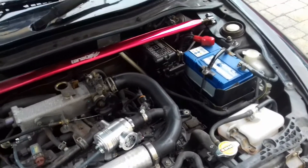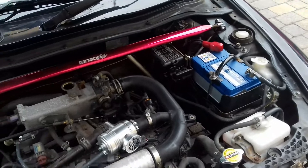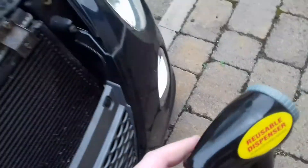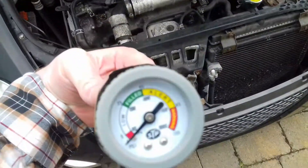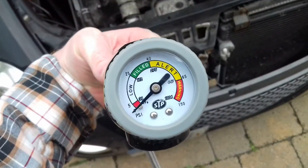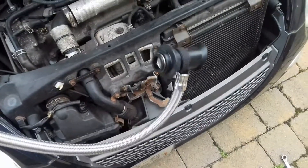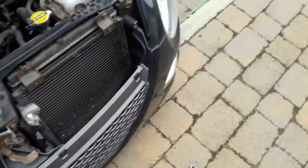You can do this at home. The kit costs you roughly about 100 euro, you can get them cheaper, and you will need one of these trigger dispensers, a pressure gauge, and the low side port clip. You don't do this on the high side port.